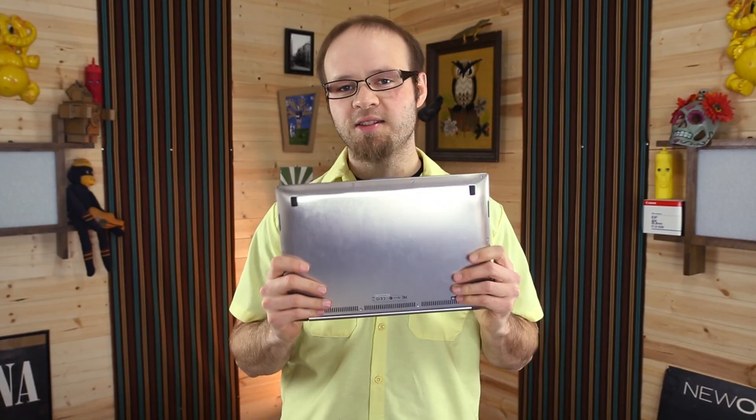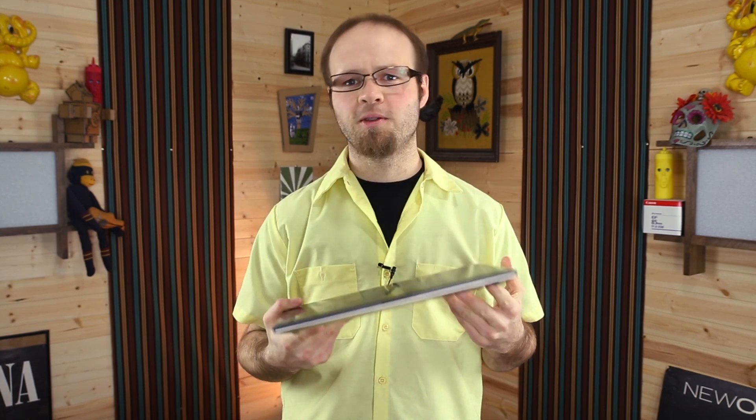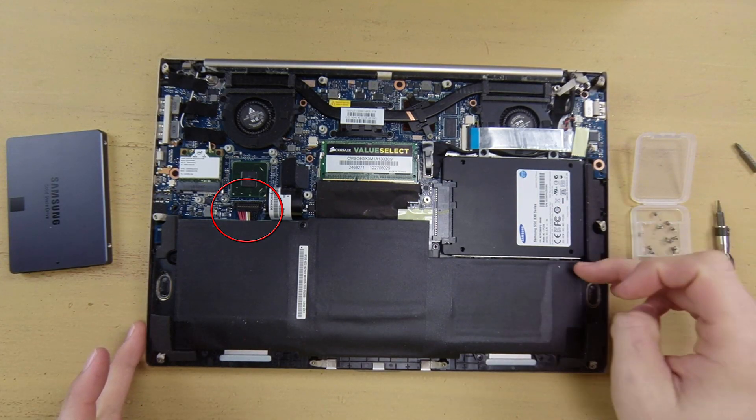That's pretty much it for the installation of an SSD into the ASUS UX32VD laptop. This thing is a lot faster now, and you can check out the stats on the new hard drive over at DSLRFilmNoob.com. One side note I forgot to mention: there is a little multicolored ribbon cable that comes off of the battery — that's the battery connection to the laptop. If while you're messing around with the battery you unplug that, your laptop won't turn on. So make sure you keep an eye on it and push it in nice and tight when you're done. I'll have a full write-up on this over at DSLRFilmNoob.com. As always, thanks for watching!